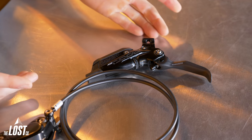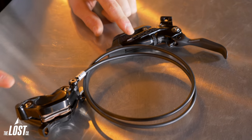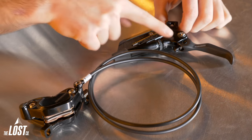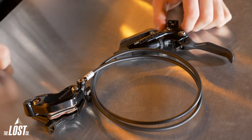Let's take a very basic look at a mountain bike brake. We've got a lever — or lever, depending on where you're from — which is connected to a hose connected to a caliper. When you squeeze the brake lever, there's a small piston or plunger inside the lever body right here, which will force fluid through the hose and then into the brake caliper.